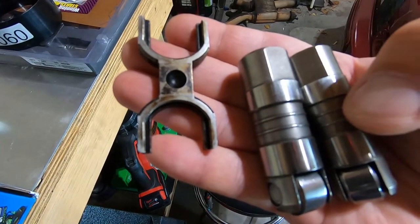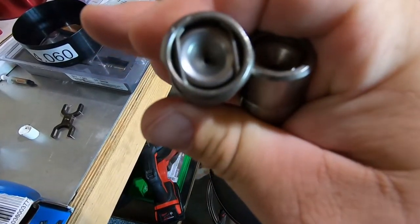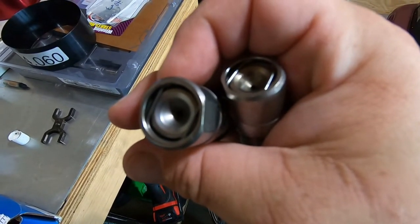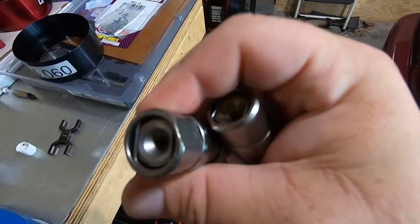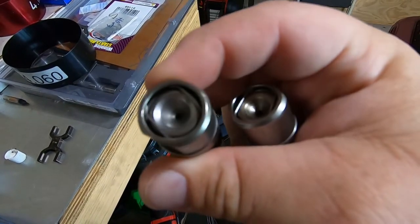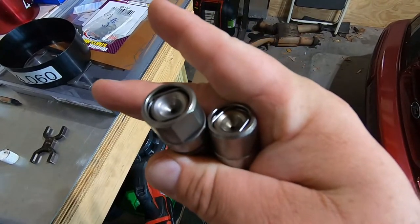What I have here are two stock-style hydraulic roller lifters with the dog bone. These are my checking lifters, not the ones I'll actually use. What I've done is taken them apart using the C clip — if you take those C clips out you can pull the plunger out, gut the lifter, and stack up small washers inside. Then put everything back together. In essence you're making your lifter solid so the piston doesn't compress it during your push rod length checking process. I keep these in my toolbox for every engine I build.